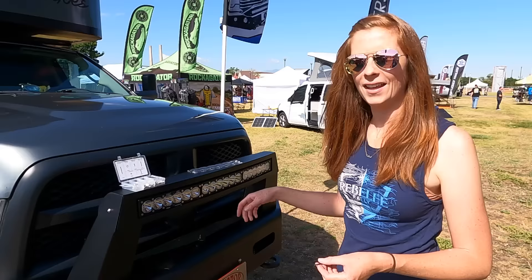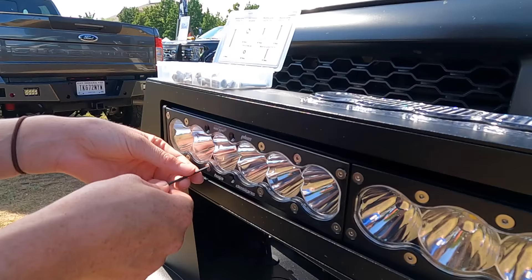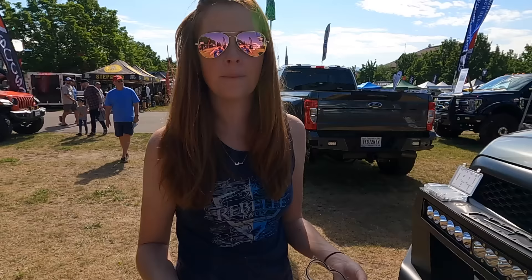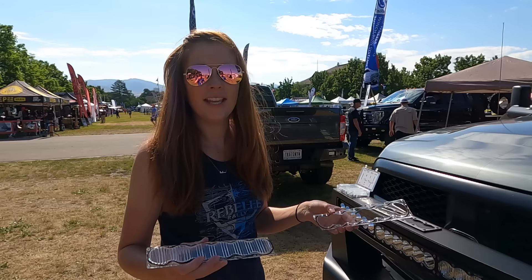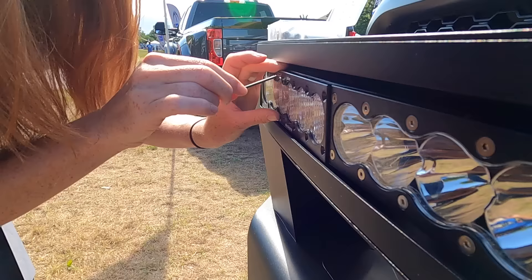No tools, no drilling, and a perfect fit. The way this light bar can be configured from Baja Designs — all three were spot lenses — so what I'm doing is switching out the two side spot lenses for flood lenses. The spot one is completely clear and the flood one has ridges to help distribute the light. Our thinking is we're never going to go fast enough to need spotlights super far out, so a wider, more dispersed light would be better. It's really cool that Baja Designs has different lenses — you order one light bar and then make tweaks to configure it for your setup and intended use.